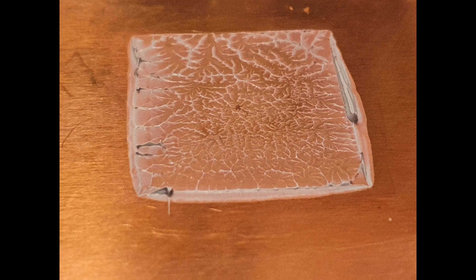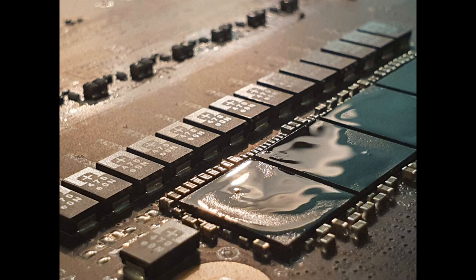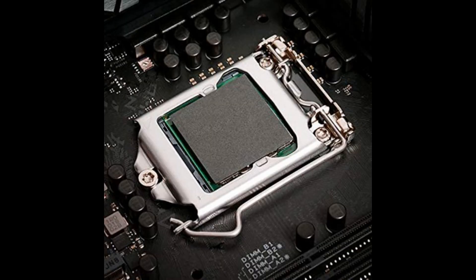I'm just mining Ethereum on most of them so it would probably work okay, and I don't think I'd have to take it apart as often. Thermal paste typically dries out over time through many heat cycles, and if you're running them fairly hot you'd have to replace it after a while. This stuff doesn't bake the same way and doesn't oil, so I think it could be a good alternative even to Carbonaut, which is considered a low-maintenance option.